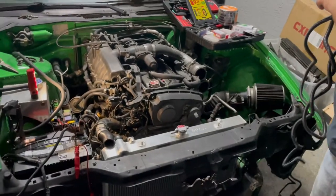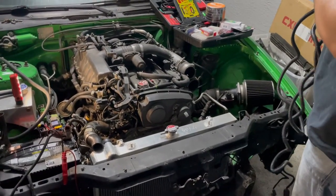It's time to make it pretty. Let's go ahead and do that real quick. After this I'm probably gonna try to start it after I put the intercooler on, just to see what it does and see if it holds idle. Because as of right now it doesn't want to hold idle — that's because it has a massive vacuum leak.